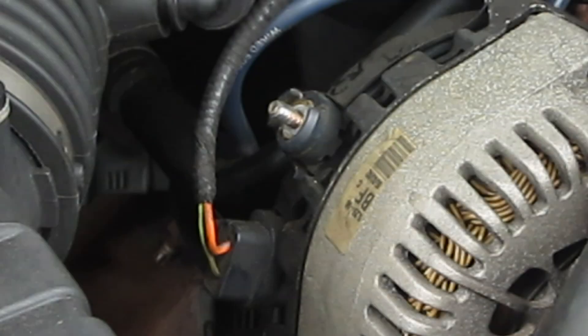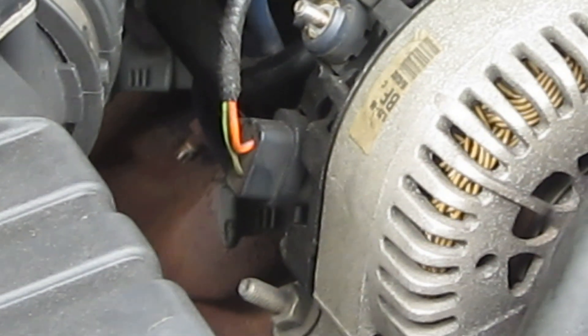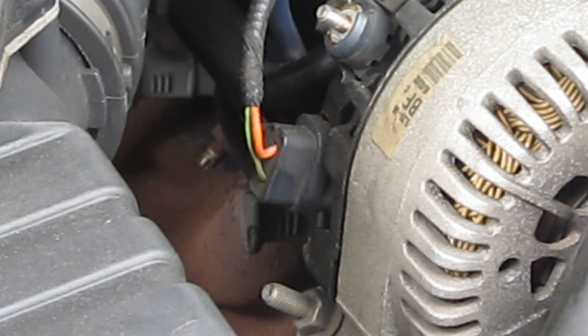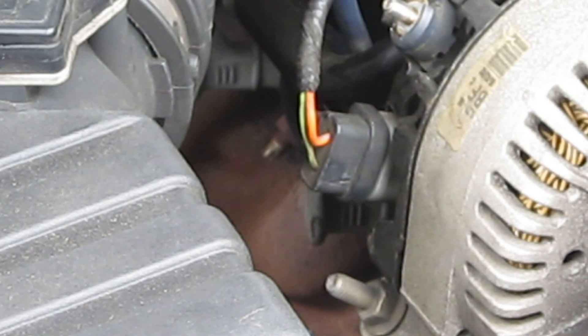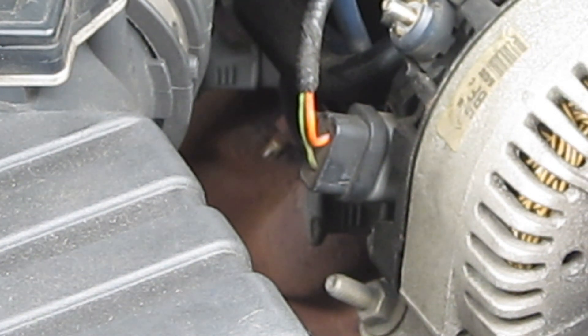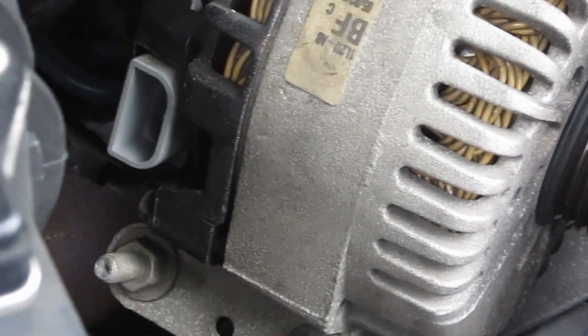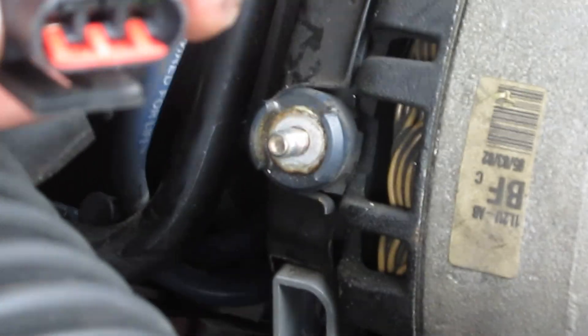There's a nut for that one. Let's get this plug off — may need some pliers or something to try to pull that out. I think there's a little release on the back that you gotta undo. For the second plug, I found that if you kind of reach under here and there's a little tab that you gotta pull up on — you pull up like that and then the plug just pops right out. It's got this springy plastic thing, so you gotta pull back on that, and then this plug will come out.